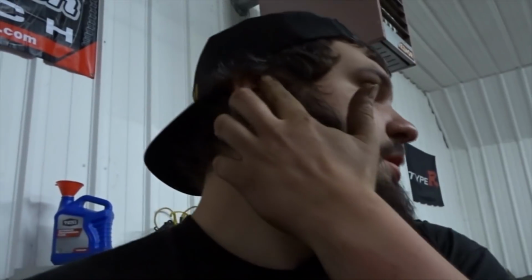I don't think I told you guys about the Civic. I took the intercooler up by 821 Bravo, and there was a giant crack in the intercooler. The end tank was pretty much almost blown off. And we fixed that big old boost leak. I put a Tial 44 millimeter wastegate on it, and we fixed another little boost leak that the intercooler had. And now I think the car will fly. I did a test on the street the other day, and I can make up to 40 pounds of boost if I want. I made 30 pounds of boost pretty effortlessly, and I feel like this thing will go full send, and it's pretty much ready to go.